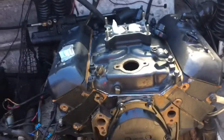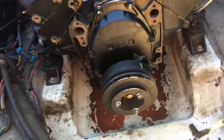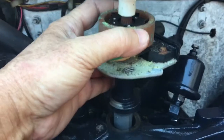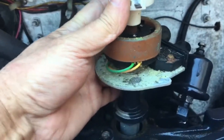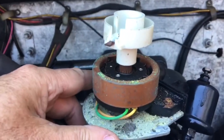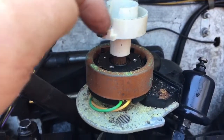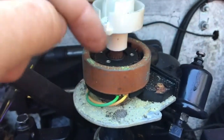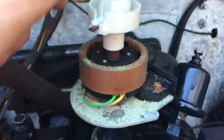That's not usually the case. I've got the engine on the number one cylinder, top dead center on the firing stroke, and I'm about to put the screwdriver in. As I drop it in, let's see if it engages. I rotated it back just a little bit — boom — and it's all the way in. The problem is, see how it's off? It's not pointing to the front of the engine. If I turn it towards the front of the engine, I actually missed it. So I've got to pull it back out and rotate it so the rotor is pointing straight up towards the front, in line with number one. It needs to be pointing right there, not over there. I've got to do this over.